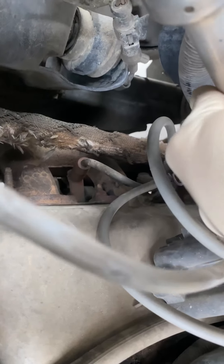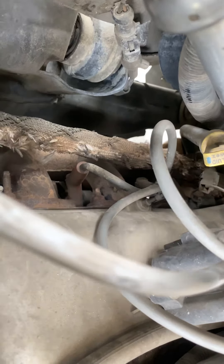That's the capacitor for the coils. That one touches the exhaust pipe there — the EGR pipe — and obviously shorts out. Now let me pull it, and you can see it touches on the manifold. You can definitely see it's burnt.